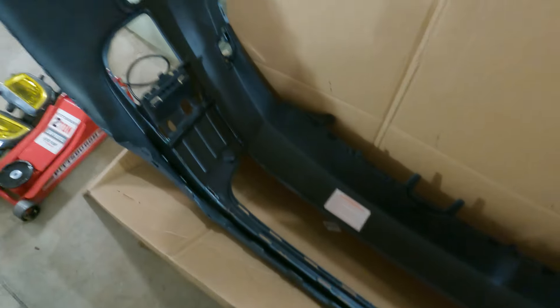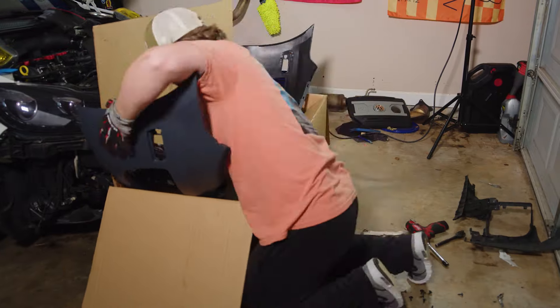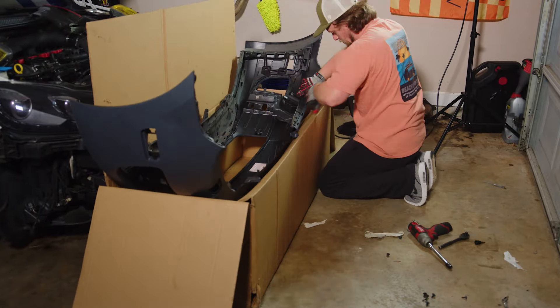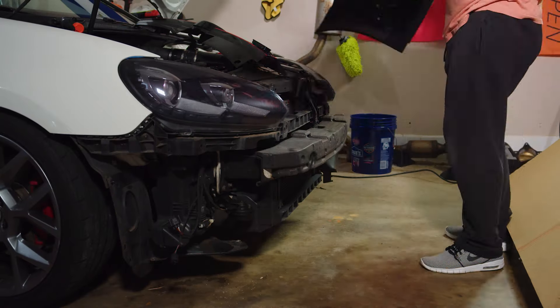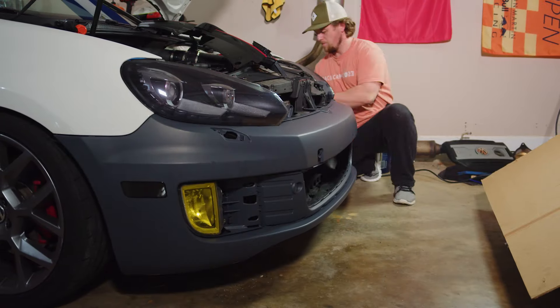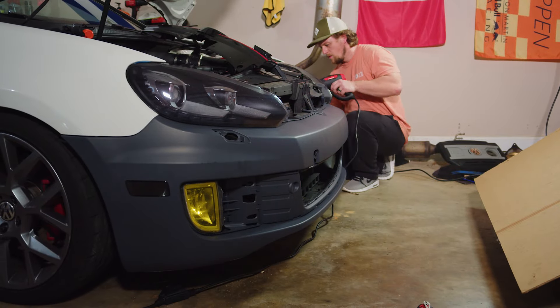When they folded the bumper you can see that little clip is bent, and there's some bend up there too — I'm gonna try to heat gun that all back into place. Once the JB weld secured, I began reassembling the necessary pieces onto the new bumper. The eBay bumper surprised me in how well the pieces fit into place. Getting it onto Elsa took a bit more heat and coaxing, but it eventually fit.